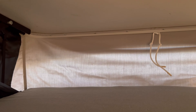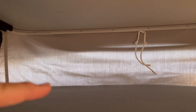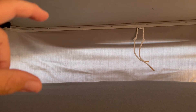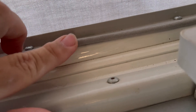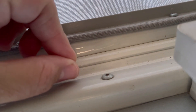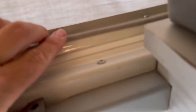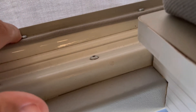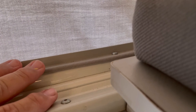When I got to installing this, I took out the original and cleaned off all the silicone. When I got to the very back, which is kind of tight to work in, I realized the canvas from the roof to the bottom was taller than the original canvas. That posed a problem because I wanted it to be nice and tight with no wrinkles. The only way to achieve that would be to pull that cord - which creates this little wall here - out about an inch or two from the track to make the rear portion tight. Unfortunately when you do that you no longer have a nice beaded seal, though it's still screwed in and siliconed from the outside. I didn't like that - I wanted it to look just like the original.